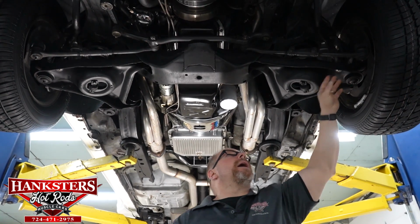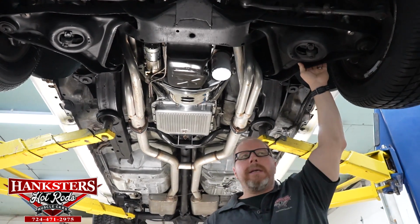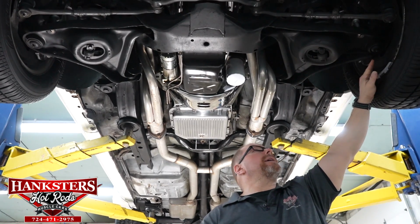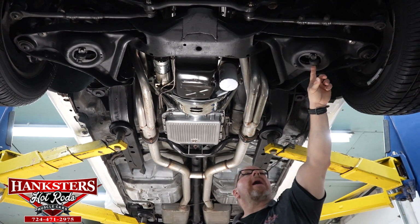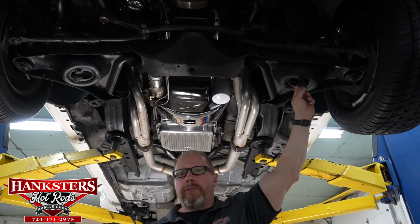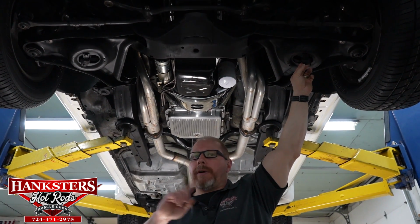so all of that looks to be in good shape. As far as the rest of the suspension, you've got just your typical stamped steel components, OE here, as far as the upper and lower control arms go on the car. Now out at the end, your ball joints, those all look to be in great shape. The shocks, all the mounting hardware, the shock bushings at our mounting points, all look to be in really good condition here. So that's your suspension.